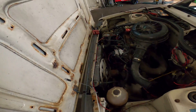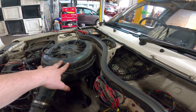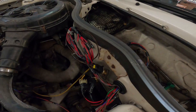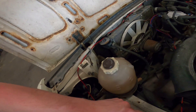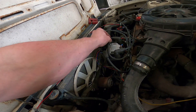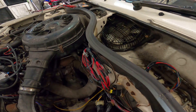I've bunched up the spare cables — throttle position sensor, fuel injectors and that — because I haven't got an inlet manifold for fuel injection yet. I've plugged in a coolant temp sensor and an air temp sensor just to clear some of the fault codes the Max ECU is flashing up. I've run the hall sensor trigger cable quite long deliberately because I don't want it picking up interference from the high-voltage HT leads. It runs across the top of the rad and jumps over into the distributor — not perfect but it works. It should actually run now, let's give it a go.